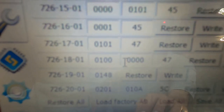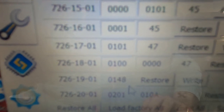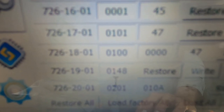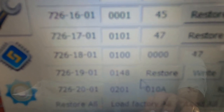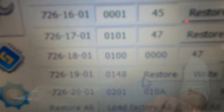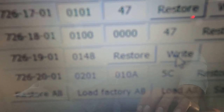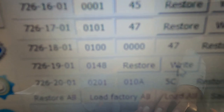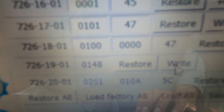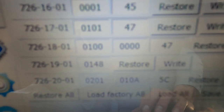When you don't have remote start enabled, it's going to say either 0047 or 0048. Mine said 0048, so I changed it to 0148 — basically add 01 to the 48 or 47, whatever yours had. Click write, and that will change your system to receiving a remote start. It'll enable it and should work after that.